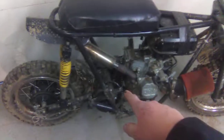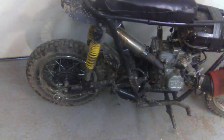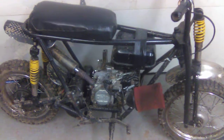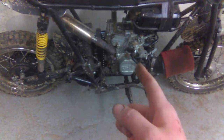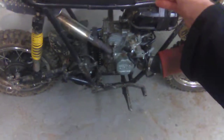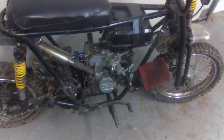So that's why I have the tranny oriented like that, where I use that regular input, and then it goes up, and yeah, it works pretty well. And it also makes the motor look interesting mounted sideways like that. It's definitely skinnier than one of these with a torque converter on it. Like this motor with a 30 series torque converter is definitely wider than it is long. You know what I mean? So if you turn it that way, yeah, it works good.